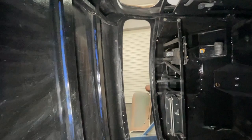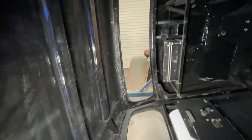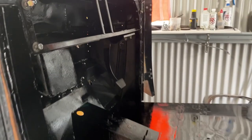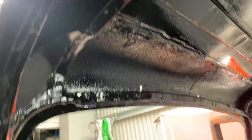I've done a little repair up here as well. Again, I just did it really rough and now that's ready for the rust paint again, which I'm sure you've seen in another episode if you've been following me. More around the front - I've even fixed up around the windscreen, or where it sticks on at least. It's hard to show you there, but I've put a little bit of fiberglass filler in that and also a little bit of paint. I've been painting all morning, getting all the cab repainted inside and up in the roof.